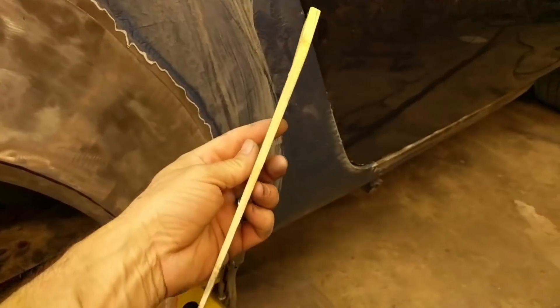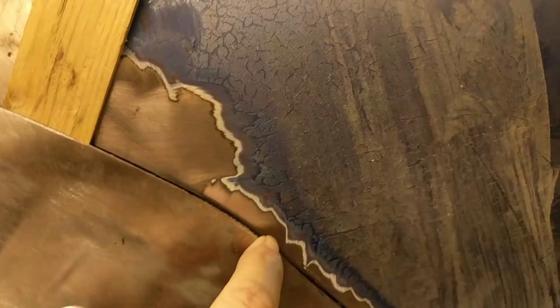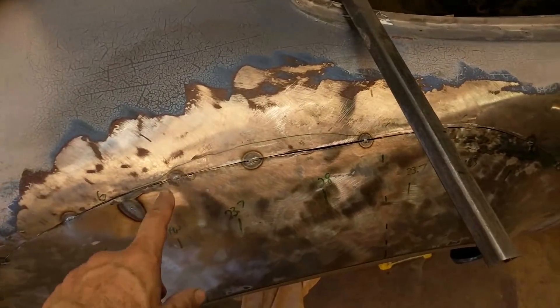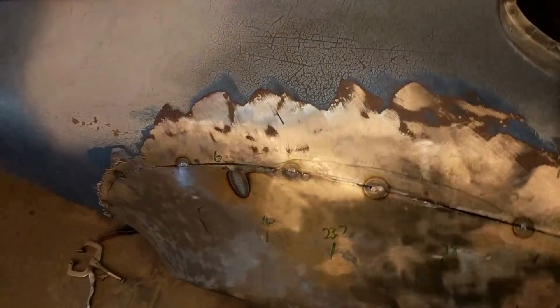What I'm doing is using a tapered door shim for house construction — I'm sliding it in and then grinding along this top edge until it fits, then pushing the panels together until the gap is zero or a small gap. I'm doing that all the way around, and I'll put a tack in on the top. So this is now in place — fully trimmed and tack welded every couple of inches. It's in its final position and I'm pretty happy with it.